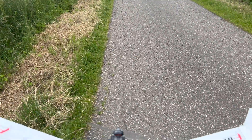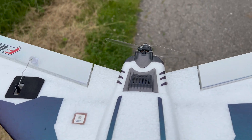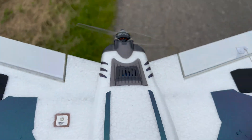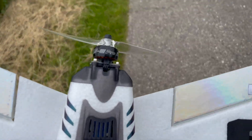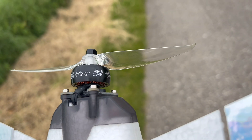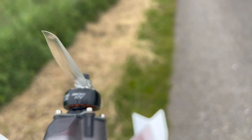We're down the road again and this time we have the F01 Power Cruiser. I've been one of those guys telling you that a 2806 or 2807 motor with a seven-inch prop is awesome — and in fact it is, you get endless power — but you're stuck in a certain range of stick position which gives you not much control in slow flight and not much speed. Anyways, I've switched over to something like this: a 2208 motor with 1800kV and the GemFan Flash 6x4 prop.